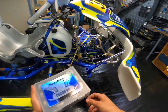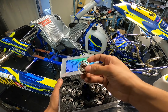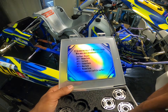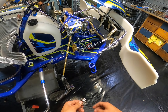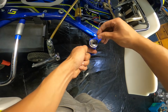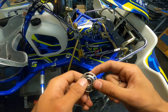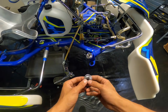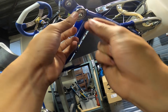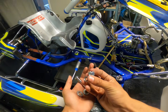Now that the system is broken down, head to your caster kit. I already have the zero-degree one installed. You can tell it's zero degrees because there are no dots. The kit description also tells you what each ring is — zero/blank means no caster, and the five-dot one is maximum caster. To put it back together, place the ring in here and make sure it's aligned with the screw holes. Before slapping it in, note there's a tiny 'R' marking indicating it's for the right side. Put the three-degree ring back at the bottom, align the lines with the holes, and gently put the screws in.